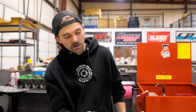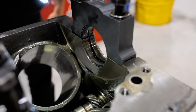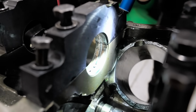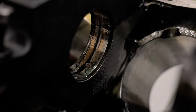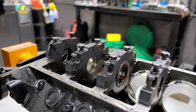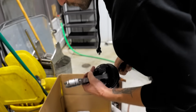Bearings, main bearings you can see right here, really look pretty darn good all the way around. Until we get to this one right here, which is the journal that feeds this rod journal for the 2 rods that kicked out. That one is junk. And we can confirm that by the 2 missing rods that were there. And then we can look at our not bad rods.